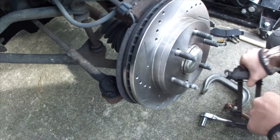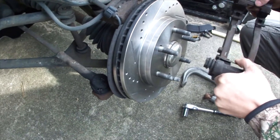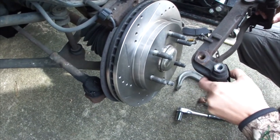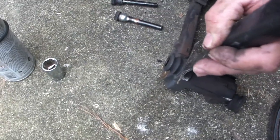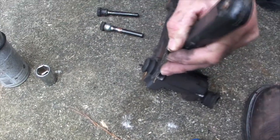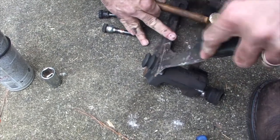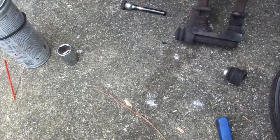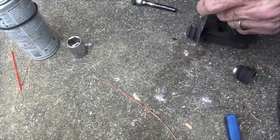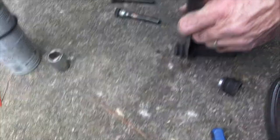Let's clean the mount assembly, get those slide pins or slides off, and then we'll put it back on. Well, we got one boot off. Let me show you how we found to get these things off. They are pressed in. And yeah, I'm using a painter's tool, and that will allow me to work my way around it. And that painter's tool will get underneath of it.